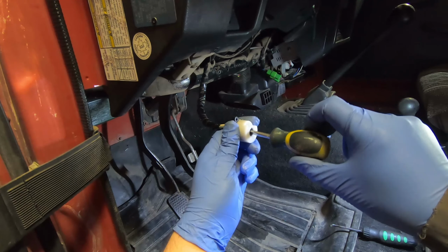So again, I've got this nice and level on the three contact points. I had to put some solder in there just to build that up a bit because it was getting some cracks. I'm going to take the spacer out, and the reason why is I'm wondering if there's too much play inside the switch. And when the spacer is in there, it just raises. So this tang locks into that notch there, and when it turns, that's what turns this copper contact around. But I was wondering if there's too much wiggle there, and there's not really much, but maybe when it was up higher from the spacer, maybe that's what was causing that there. So if I bring it back down, maybe that'll help.